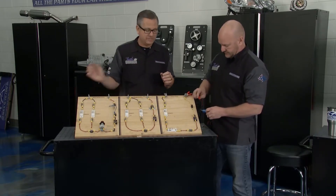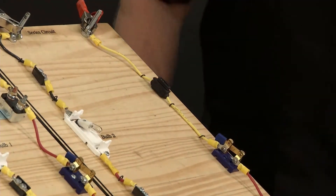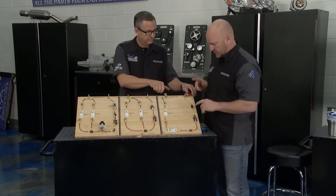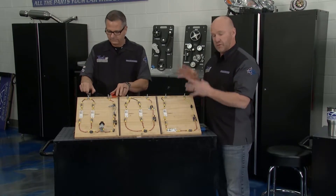So it's going to continue to do that until you go around, isolate that circuit, go to your service manual, find what's on that circuit — or it could just be the boat trailer. So what you want to do is detach the truck, decouple the truck from the boat trailer, and run this test on just the truck. If you don't have a problem, the problem is in the wiring harness of the trailer.